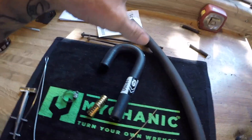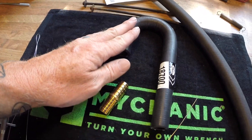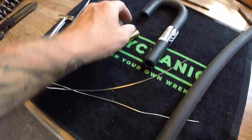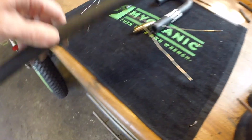This is the piece I picked up from O'Reilly this morning — there's the part number, it's a Gates product. I'm not sure what it originally fits, but like I showed you earlier, I'm going to take these two pieces — since this isn't long enough I have a brass barb — and use my Clamptite tool to put them together. Then that'll go down and drip on the ground instead of all over the top of the engine like it's doing now.